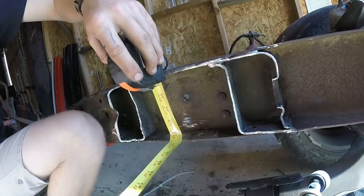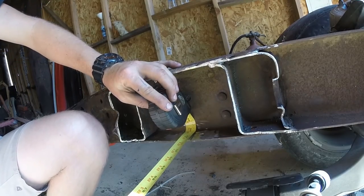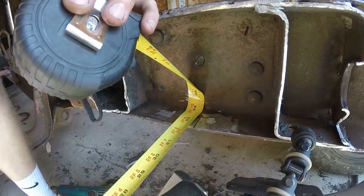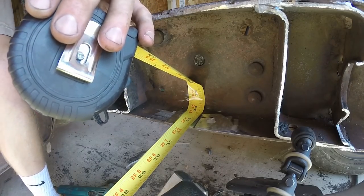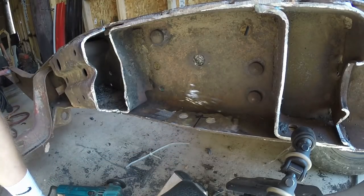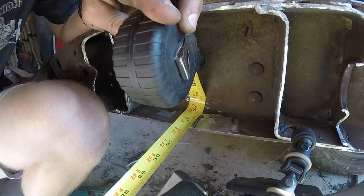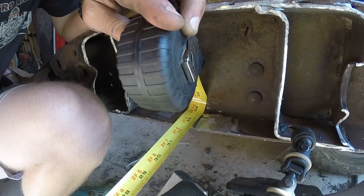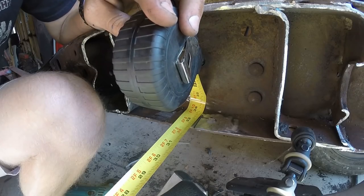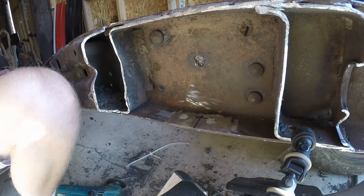I've been taking off two inches off each side. The 33 then becomes my 31 and a half after that - it goes right up to where I was before, so my half-inch mark lines up right with my line. Now I take the punch and try to hold all this - okay, so I have a tiny little punch hole. Before I keep going, I'm going to measure it again. It's a lot of measuring, but I want to make sure it's straight the first time. The half-inch mark goes directly into the center of that punch hole - it is perfect. I measured it four times, so I know it's good.